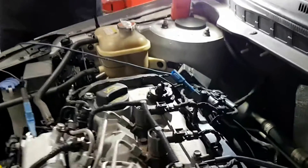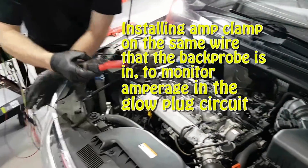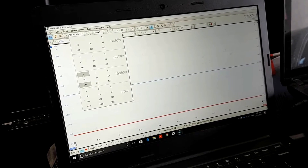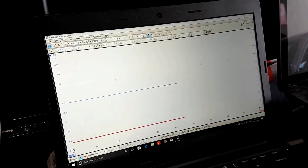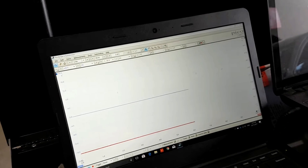Okay, so we're into the back of that one. On channel 2 I'm going to grab my low amp clamp because I'm not expecting over 60 amps. Turn it on, make sure it's zeroed — I can see the zero line, but I'll press zero anyway just to make sure it is zeroed. We're good to go. I'm on a time base of 100 milliseconds but that's too quick — we're not after speed here, we want to see things happening over time. So I'm going to put it on one second per division. Our blue channel 1 will read 20 volts, and our red channel 2 will read 60 amps, both at one second per division. Not too concerned about sample rate because glow plugs are slow, so we're going to see the whole event.